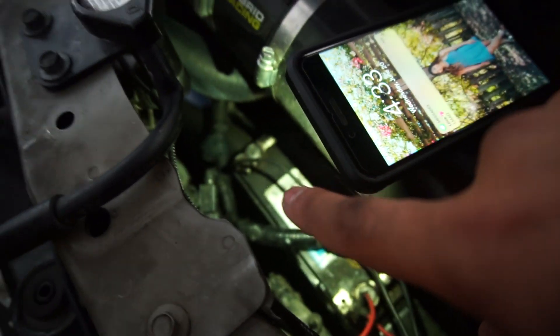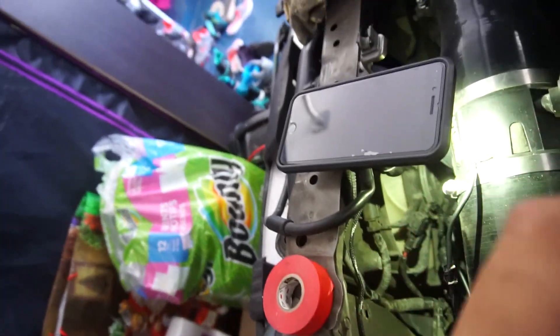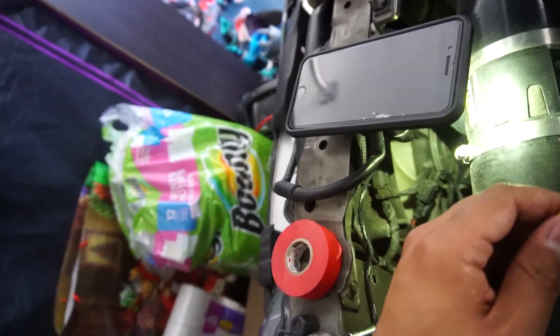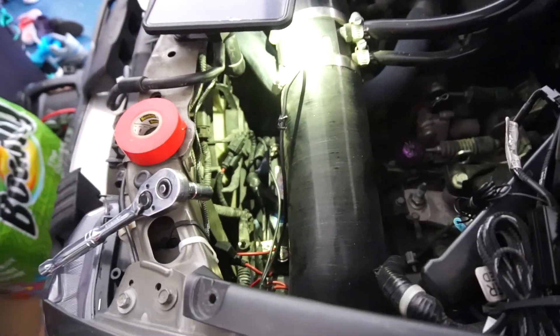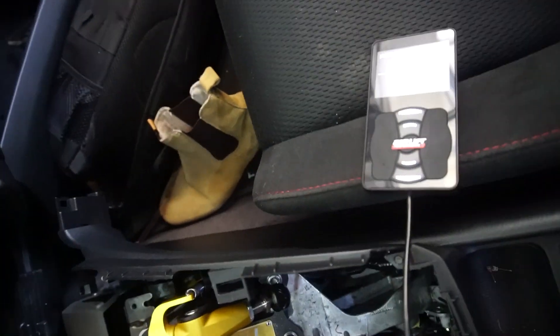Let me fix the ground because I just want to turn on this car already. The exposed ground — what I'm going to do is put it on another one of these and just crimp it, because I guess when we did it nobody crimped it to anything; they literally just taped it onto that piece. Hopefully with this we can connect everything together and have it functioning because I'm really getting tired of doing electrical stuff. This is the moment of truth — please I really hope this works. I want the controller to turn on, I want the management to turn on. We're live baby! Both compressors turn on!